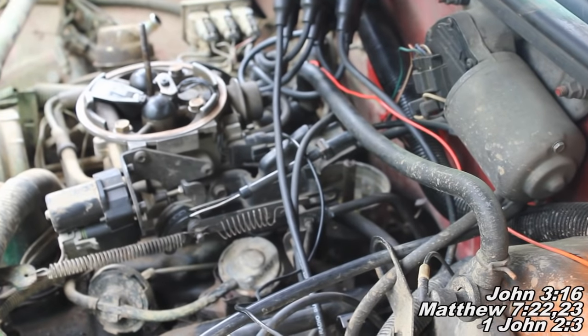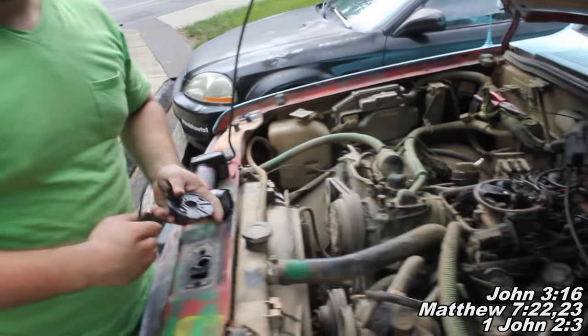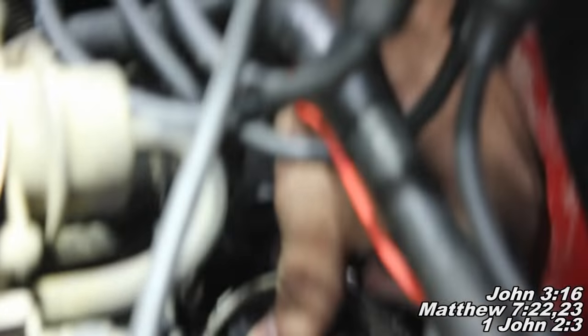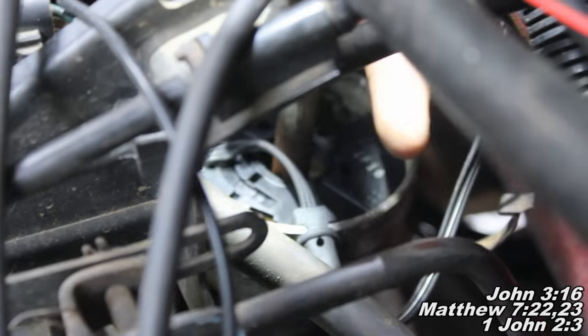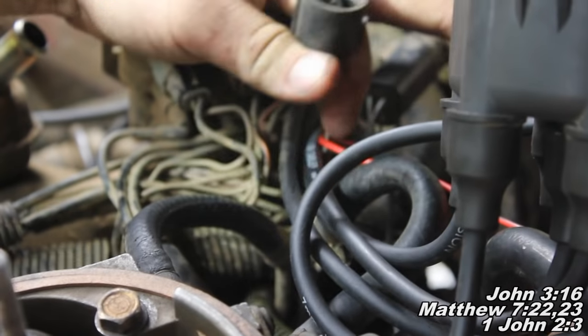Here in just a second I'll show you the installation for this piece. Okay guys, we have our new sensor here. We're going to go ahead and set that bad boy in. Now, there's a little groove in the side of the distributor right here — you just got to press the wire down into it so that it doesn't get in the way of the cap. The wire is down on the side of the distributor now. You're just going to set your wire — you can see how the rubber fits in there, just kind of sits down in there. And then make sure to re-plug your ignition coil pickup sensor. The female connector just plugs right in over there. We're going to go ahead and plug that in and then we'll get everything back together.